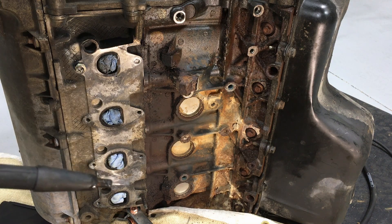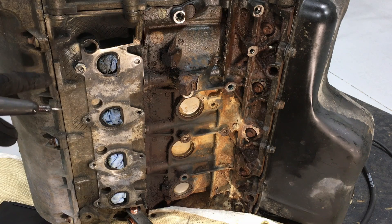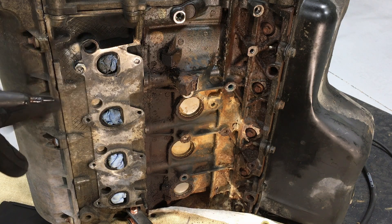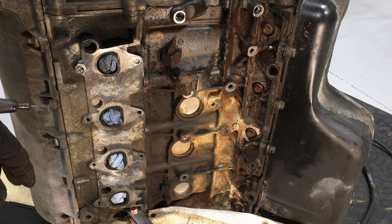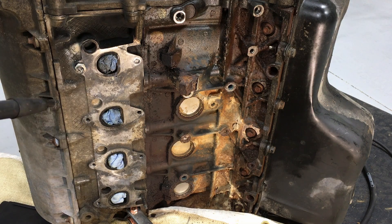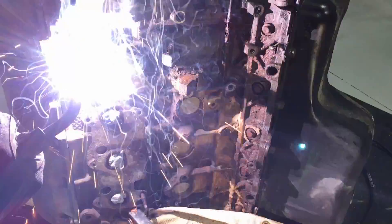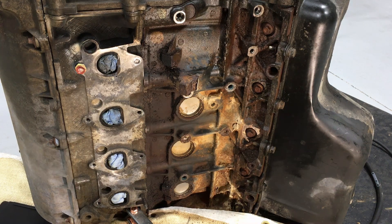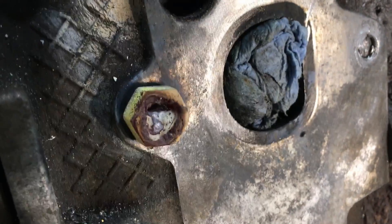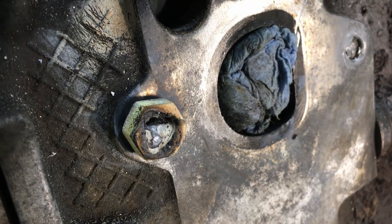The reason I let it cool is I was blowing out the side of the nut with too much voltage. What we do is build up a little bit and then do it again — with enough build-up, this thing will probably turn right out of there. Once it's basically flush and you've got quite a bit of weld in there, it should come right out with a good bite to it. Let it cool for a second and we'll try turning it out with our wrench.